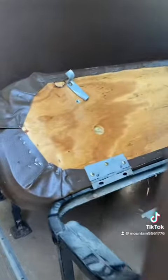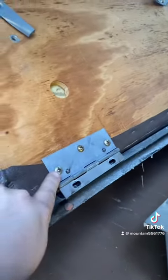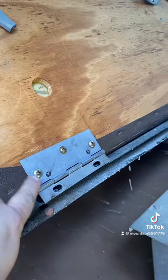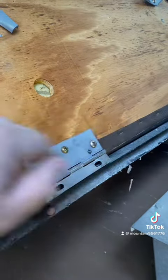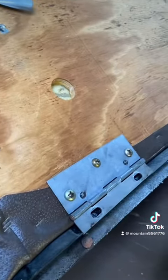Did you ever want to know how to remove a bus seat? Well, come follow me and I'll show you. Underneath the seats, you have these hinges, gonna have some screws. They're right there. They're all the same right here. You take those off. Underneath there's these little hinge things. You swing that and it swings open like that.